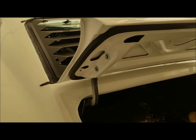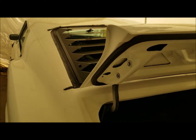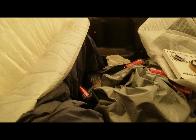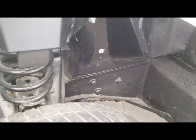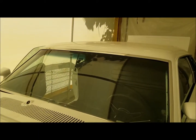At the front of the car the whole front end was redone — everything from the firewall, which was partially replaced, the whole front frame rail, and the front radiator core support. Before taking it apart, he had it on jack stands and hung strings down with plumb bobs from certain holes, marked it on the concrete — measurements, height, and all that stuff to square it up. Fun stuff. This car is amazing compared to what it looked like. I always kid my brother that he bought the rights to build a Mustang when he bought this thing.